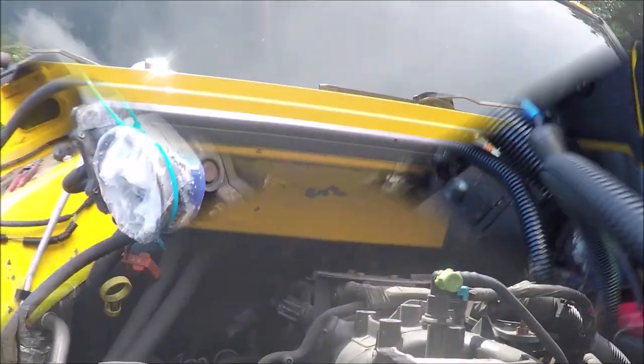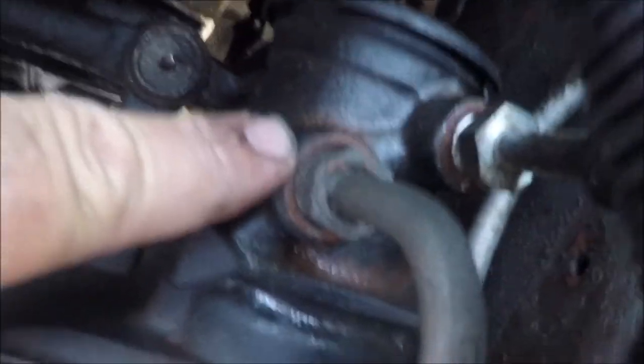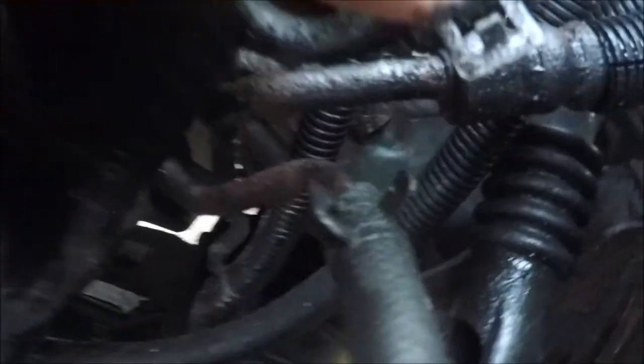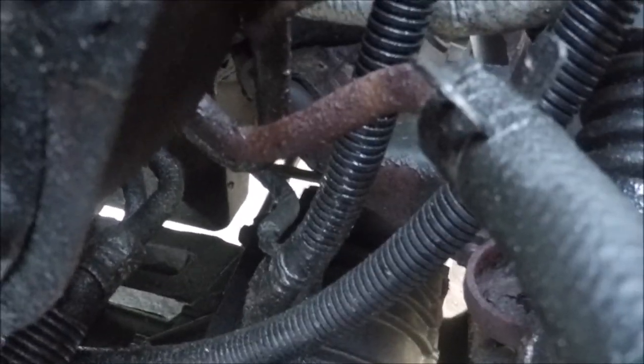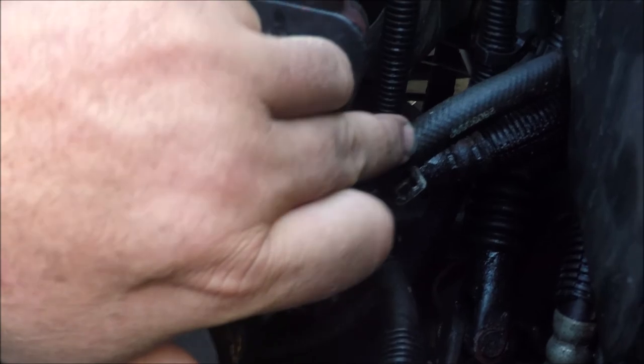We'll go from there. This video is about the power steering pump. We're going to be removing this line right here, which is the main high pressure line, which goes up the frame and then back to the pump. And then I'm going to be removing this line, which is the return line. And that line underneath the clamp, that doesn't even go to the power steering. It probably does not. That's the oil return. This is one of the oil cooler lines. All right. So I'm going to be removing this bracket with the power steering pump, taking the return hose off, which is this one, and the main line off the box. That's about it. All right, easy enough.